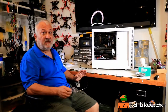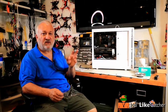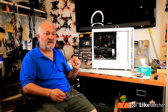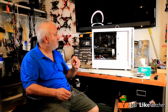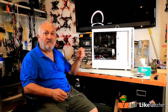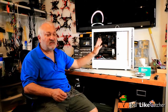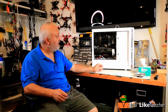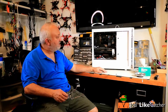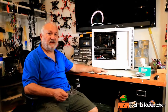Well, that took entirely longer than I expected. We had a few problems. The plastic retainer bracket that goes behind the motherboard is kind of fragile, and if you tighten the screws too much it breaks — and that's what happened. It's in there and it seems secure, but I'm not comfortable. I'm going to contact the vendor and AlphaCool to see if they'll send me another bracket. The other big surprise was I had to rotate the pump 90 degrees because it just barely fits horizontally. That top line is really stretched as far as it can. I'm going to see if they can get me an extension for that. It is a modular system, so that's entirely possible. Other than that, we're ready to fire it up.